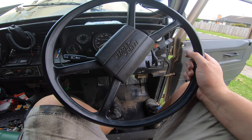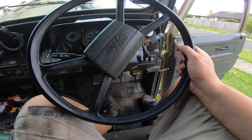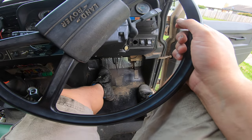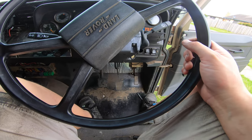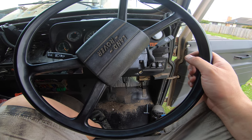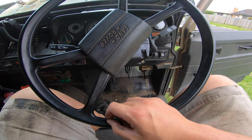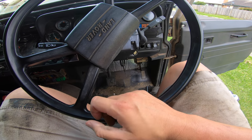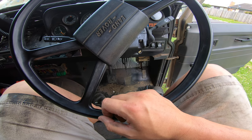I'll have to bleed it a bit more, but I also have to go somewhere fairly shortly. That's frustrating, when you drag somebody out of bed. So yeah, actually that's where my clutch is starting to take up there, so I really need more clutch throw than that. Now I probably need to get under there and pull the wading plug out and drain out the remaining fluid. I am tired. In the situation I'm in, that's relatively easy. I should just get under and do that.